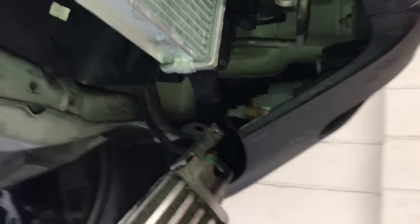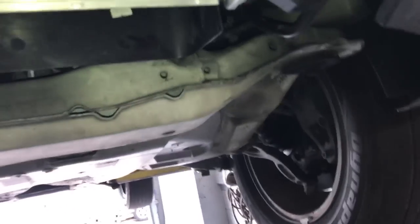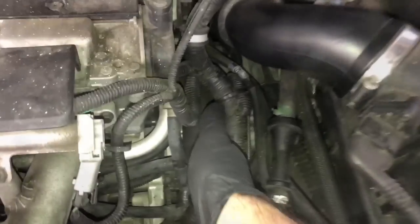Take the two coolers and swing them back up into position — the oil cooler goes on first, then the power steering cooler goes on top of it, and start the bolts on the left and right side. Once bolted back up, go back over all the bolts and make sure they're all tight. Now we're ready to install the lower radiator hose — I'm going to lower the vehicle back down and replace the old hose.